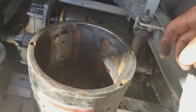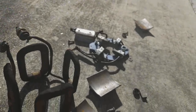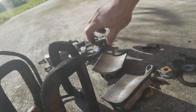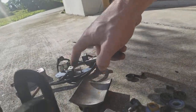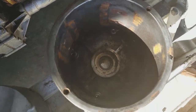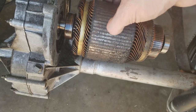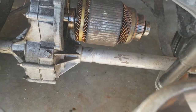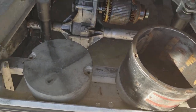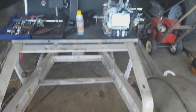When you take your motor apart, there's a bunch of bolts that go through here — you're going to want to gut this motor and take everything out of it. There's also this piece in there you've got to take out; there's just two screws that hold that in. Once you get all that out, you'll have this nice empty open chamber to hold your drive shaft. It's a 15 to 1 turn ratio on this thing, so it's hardly moving but that shaft spins a lot — gear it accordingly. I'm going with a really small gear on there and a larger gear on the motor.